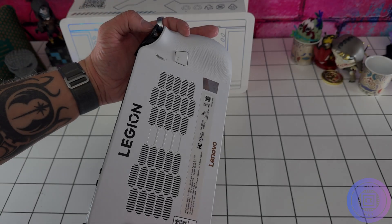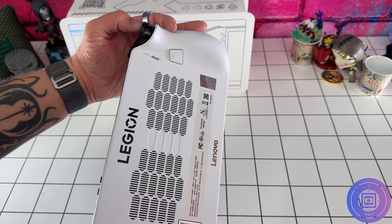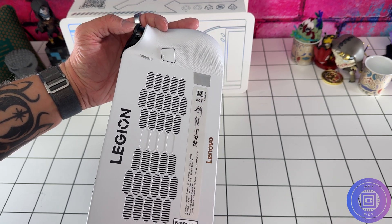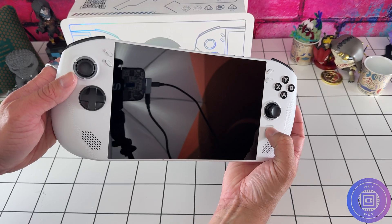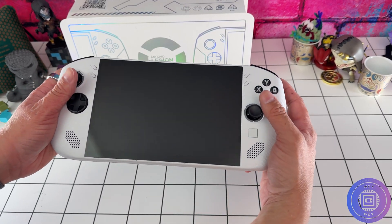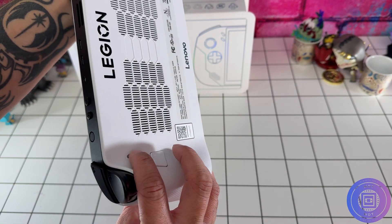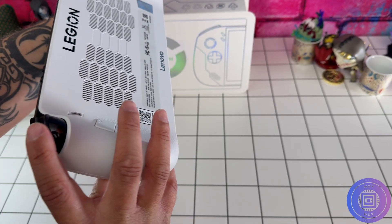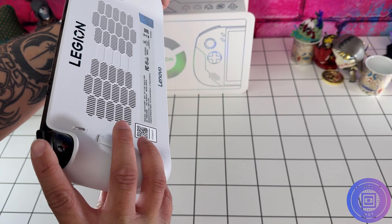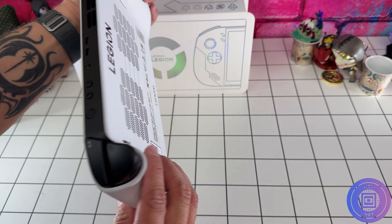To not waste anybody's time: typically when I do these types of SSD swaps, I'll just do a fresh complete Windows install on my own. I do see the need for people to clone their own SSDs, however I do not personally recommend it because there is no 100% guarantee that this will not mess up your OS in some way. If you're doing it on a brand new SSD, there's really no reason why not to — so if you do disable BitLocker and device encryption and all that stuff, you won't have any issues. I will leave relevant links and guides in written format in the description.